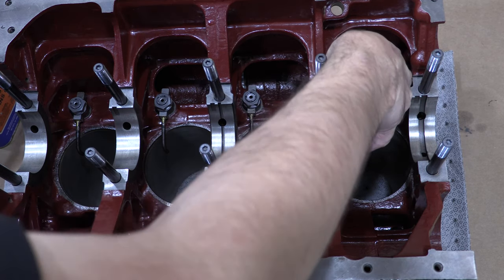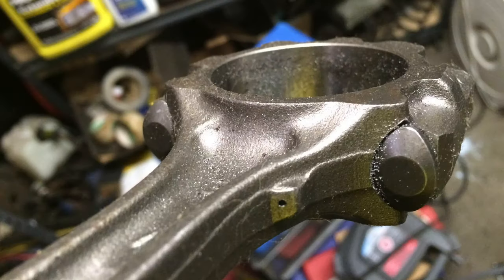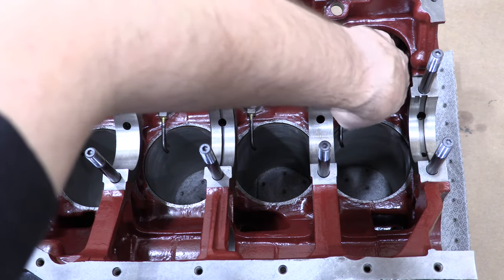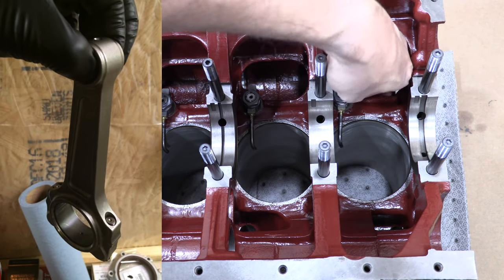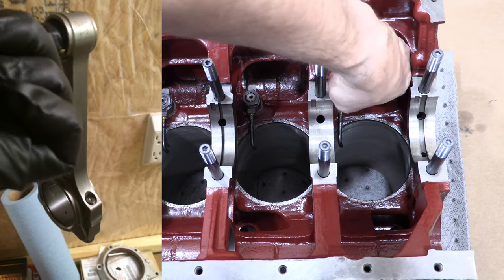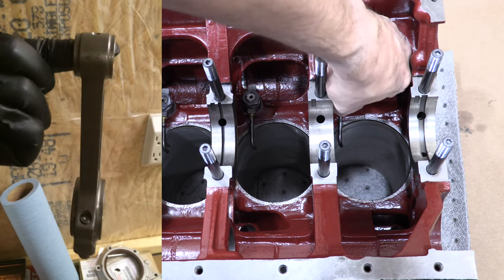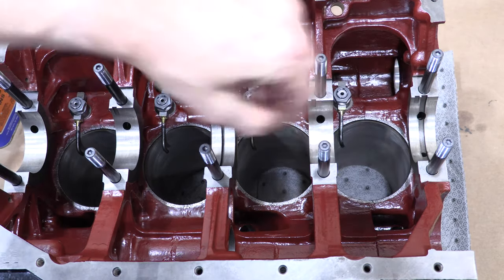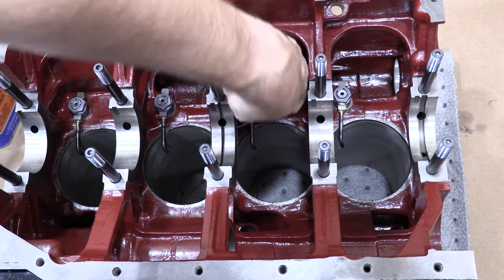If your rods have a hole drilled through the rod in one side of the big end aiming at the wrist pin, just like the factory rods do, then it fires a shot of oil twice per engine revolution at the wrist pin. But my rods that I'm installing in the GSX do not have the oil holes for the pistons and the wrist pins like the factory ones and some other aftermarket rods do, and I want those cooling benefits. There's only one illustration with torque specs for these things in the entire service manual.